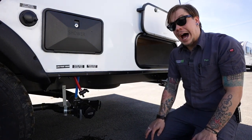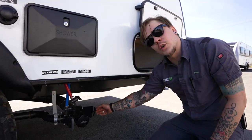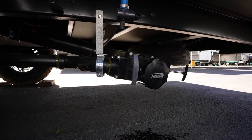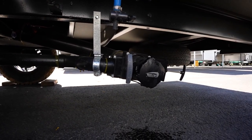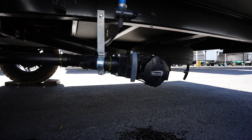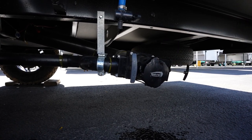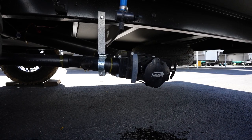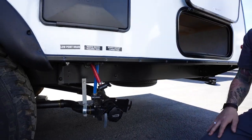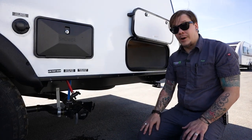A very popular option, if our tank is indicating full or we're planning on changing locations, is dumping our black water valve first. That's very easy. We give that a 6-inch pull towards the rear of the camper. That's going to evacuate that tank completely, especially if we've kept that in as wet or flowing condition as we can. Once we are confident that we have fully evacuated that tank, we close that black water valve off. We give that gray water a pull. That's going to be a 6-inch pull towards you. That's going to rinse any shared plumbing between the two, as well as rinse your sewage hose out on the way out.